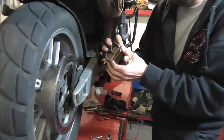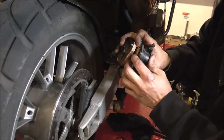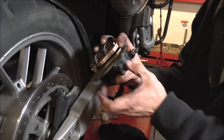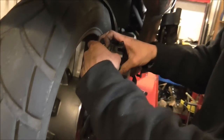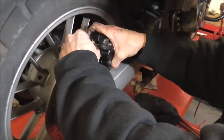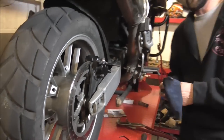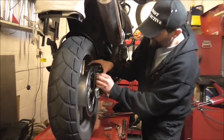Now I'm just going to make a little gap between them and pop them on the bike. It really is essential when you do this to get them right back — push the pistons right back into their seats completely — and then perhaps pump them out a bit, push them in, pump them out, so you get that bit of elasticity going. Get them right in to get enough gap. And for goodness sake, don't go twisting to try to make the gap because you'll just trash your new pads. They just snapped into place into the recess, because they are quite tight. When you buy these sintered pads they've got a little bit more meat on them than your general cheap pads, and that makes it just a little bit stiff to get on. But they will go in okay.